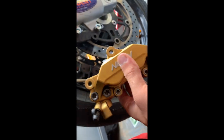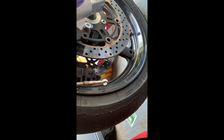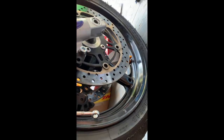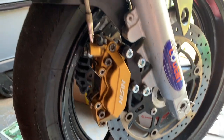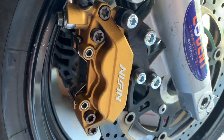Now we'll mount it onto the rotor. The cool thing about buying from Curvy Girl Racing is that they include a sanding block with every set of brake pads. Before we do anything else, we're going to clean the rotor really well with brake cleaner — there's a little grease from working on it — then take the sanding block and sand both sides of the rotor to ensure a nice clean mating surface for these new pads to bed in. Caliper, adapter bracket, and brake line are now mounted on this side. Moving to the other side to do the same process.